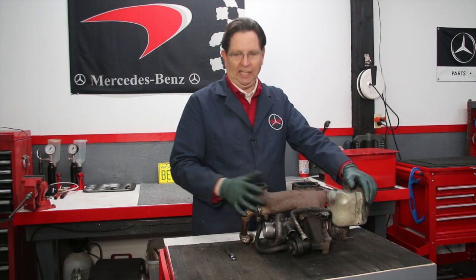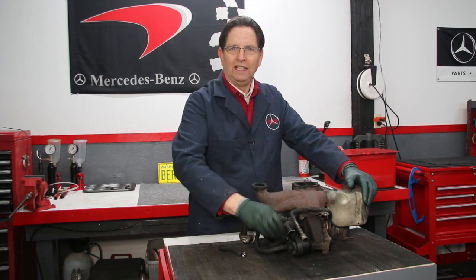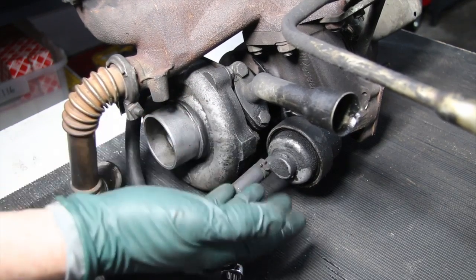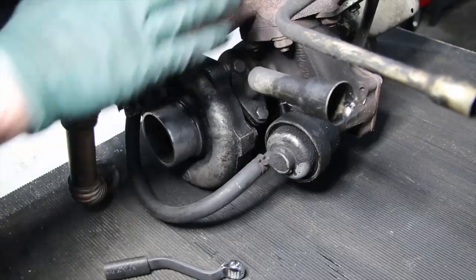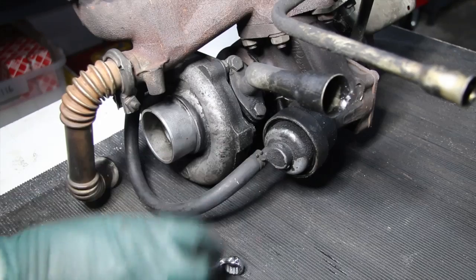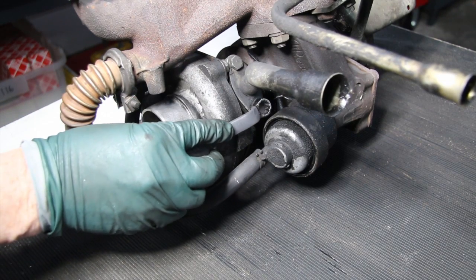That's very time-consuming just to replace a couple of seals, so we went after a new tool. Here it is — kind of a weird looking little box-end wrench. Let me show you why this is needed. When you go to remove this down tube with the turbocharger and manifold still on the engine, here are the two bolts that hold this down tube to the turbocharger center section. It looks pretty easy on a bench, but you've got an engine and other things in the way, so you can't get in there with a socket. This special little curved box-end wrench just clears the turbocharger inlet housing and gets right up over on top of that bolt, allowing you to break it free.